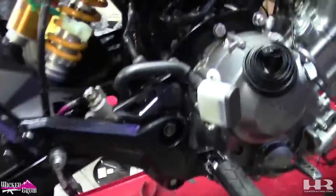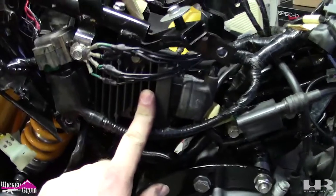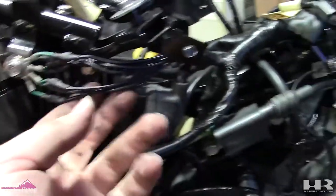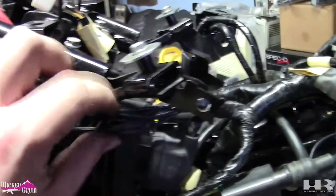Alright, update. I got most of it down. I'm not a fan of it, but I'm not going back through it — I just redid the whole wiring. We're going to be reusing the Grom coil, I left that there. Rectifier is mounted in the stock location. These are the grounding wires — I just extended these because of the way this plug is. You may be able to get them to reach, but I just extended these grounding wires. Solder, heat shrink, good to go.